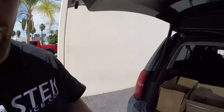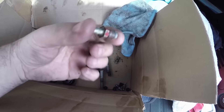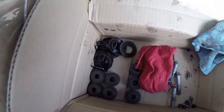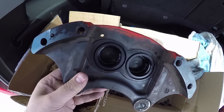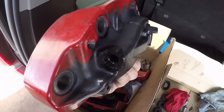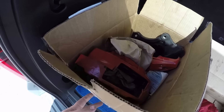You guys are probably going to hate me because I didn't record all of this, but we just pulled apart the brakes. My hands are covered in brake fluid, but just to show you guys — in this box is all the parts and pieces that hold together your brakes. There's the top nipples for the fill, there's the covers, there's the bolts that hold the two sides together, and then the actual pistons and all the seals that we pulled out. I did order a brand new seal kit — it's like 40 bucks, not cheap. Here's the inside: we pulled the inner seal, the outer seal, and drained it all out. We also pulled off the fill cap covers and all the different pieces. It's now fully pulled apart, so now we can head over to Precision Powder Coat.